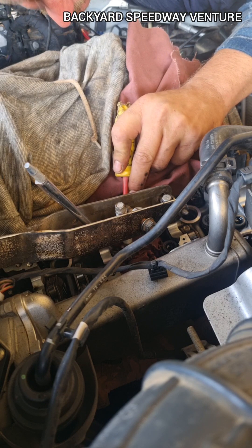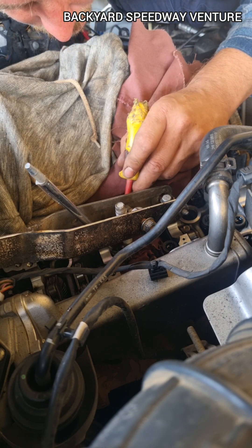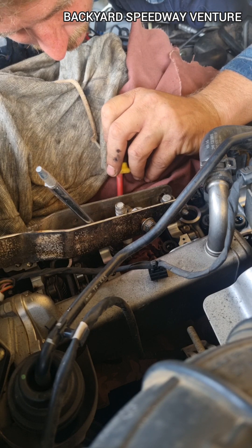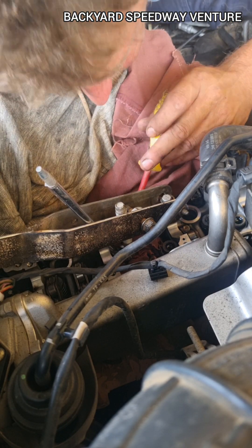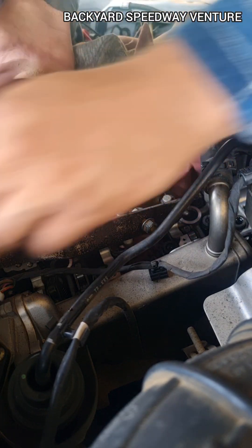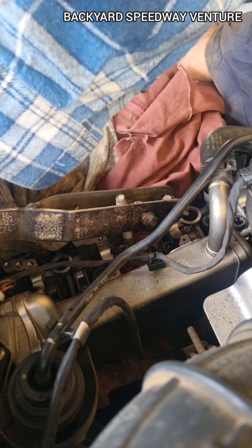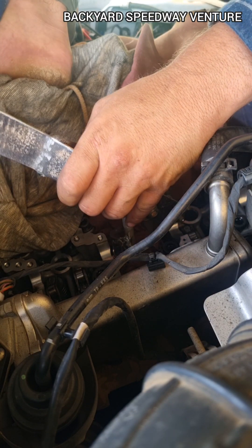It's in there. Poke it around till it finds its spot. There we go — that's one on. This isn't as hard as I thought it would be, to be honest. I thought I'd be having a lot more trouble. Mind you, I shouldn't speak too soon — it's not done yet. Alright, I've got them both in place. It's time to lift the spring up and it should catch on there. I'll just unscrew this wire a little bit — up we go. And I think that's on. Pull this out. Look at that — there it is. Valve spring's back on properly.